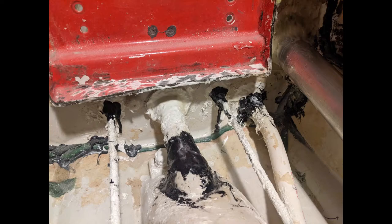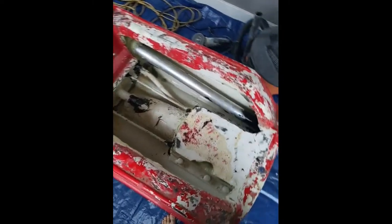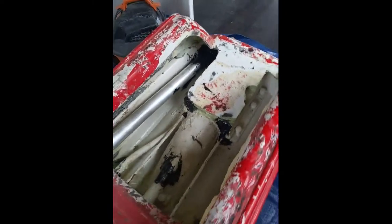This is the point in time where you should replace the water lines with new aluminum lines if they look like they've been dinged by your crowbar. And you need to put 5200 marine sealant on everything. Just go crazy. I would use an entire tube, which is unfortunately like $30. But use a whole tube of marine 5200 on all the seals. Just scoop it up with your hand and rub it all the way around the tubes and PVC pipes, and just go crazy.